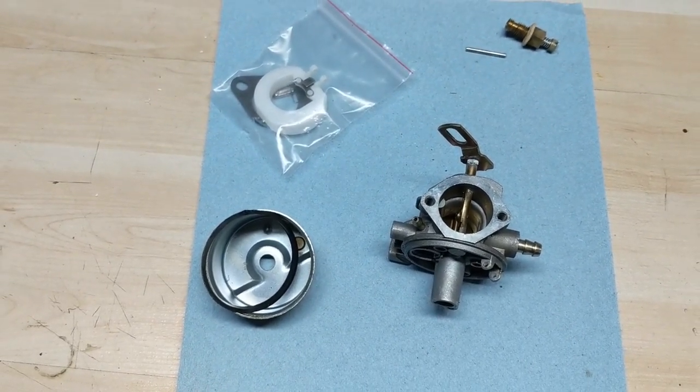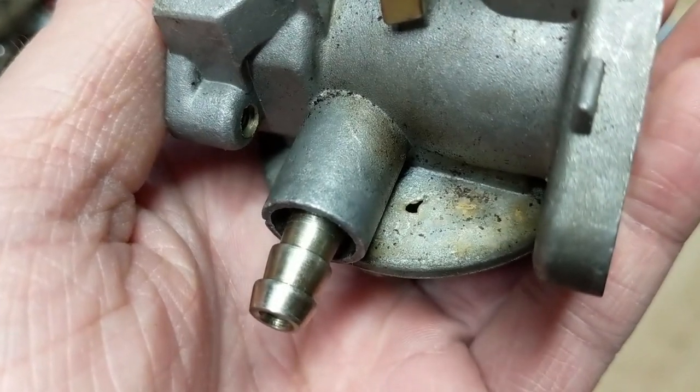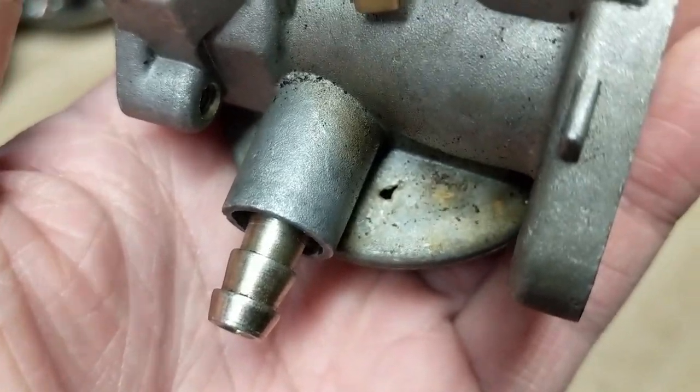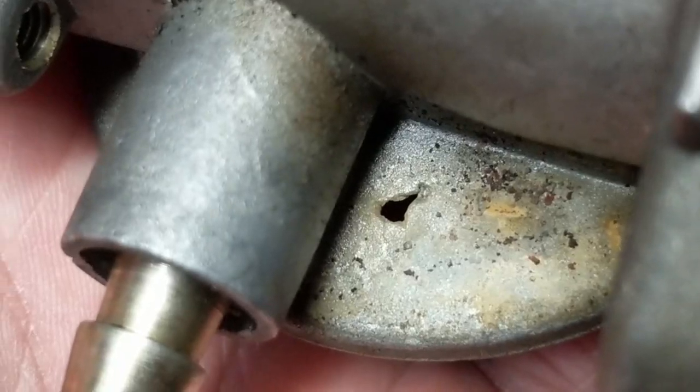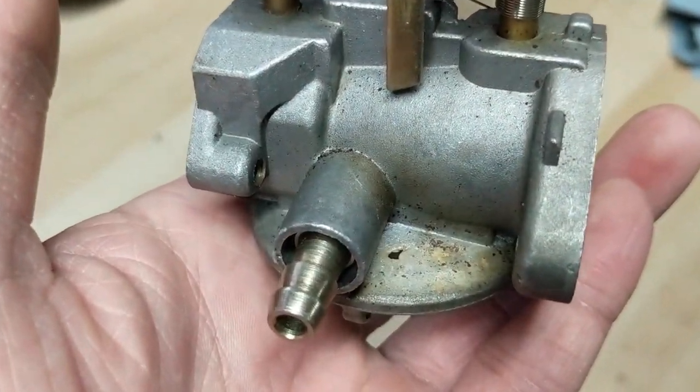They make life a lot easier when you just have a machine that wants to be a little tricky. And I just wanted to say that in my six years of doing small engine repair, this is the first time I've actually encountered this issue. So it's not like it's super common — this is definitely an uncommon issue. But for the price of these things, I just went ahead and replaced it. The aluminum was just so thin that it ended up cracking and falling away, whether it went inside or outside of the carburetor we can't be too sure, and how long this has been affecting that snowblower we're not too sure either.